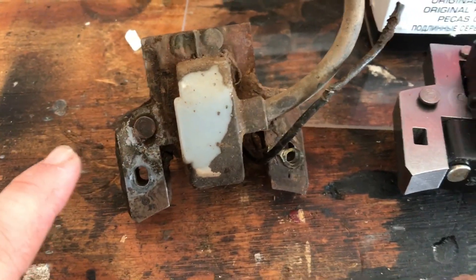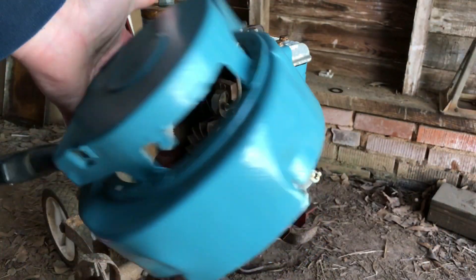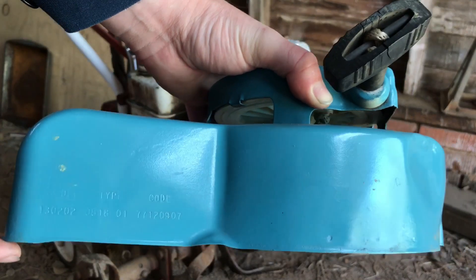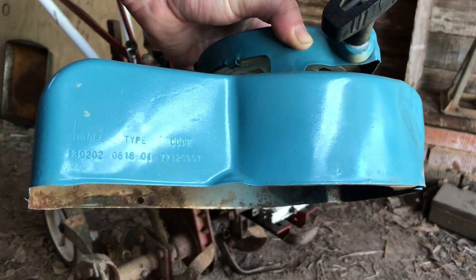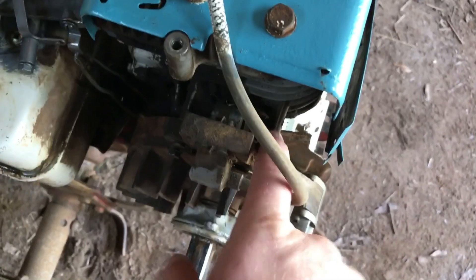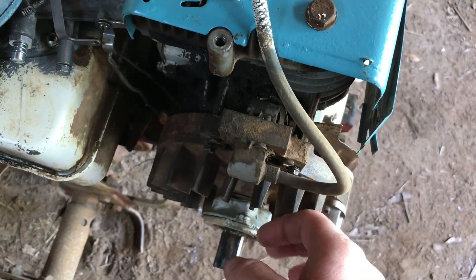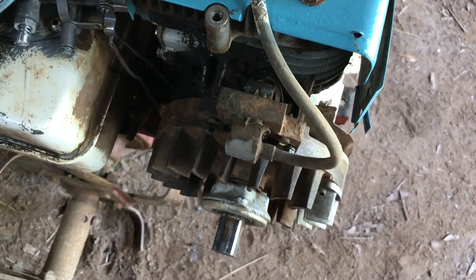You'll see this square part on the bottom of the coil that you don't see on the old one — that's how you can tell the difference between the two. If you've got an older Briggs engine and you already see that square part, it's already been converted. To start off, take off the flywheel housing cover, then find your model, type, and code number and write that down so when you go to the parts store you get the right parts. If you're not sure whether your engine has points and condenser, look at the magneto — it will have a wire coming out the back that runs down behind the flywheel, and another wire at the bottom for the kill switch.